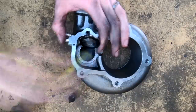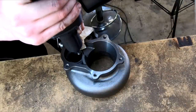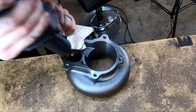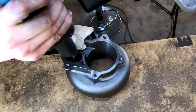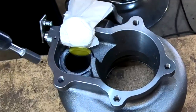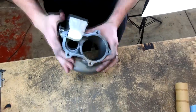With that opened up, I cleaned the flapper and sealing surface then marked the flapper to try to transfer a reference of its closed position. I figured while I'm here I may as well open the actual port itself up a little — as long as it has 1.5 to 2 millimeters to seal it should be enough. One thing I do know is we don't want to take too much from the area near the pivot of the flapper, so I left this alone. We end up with a sort of D-shape on the port — if that area is ported the flapper may catch the edge and not close, and then we'd really have bad spool speeds.